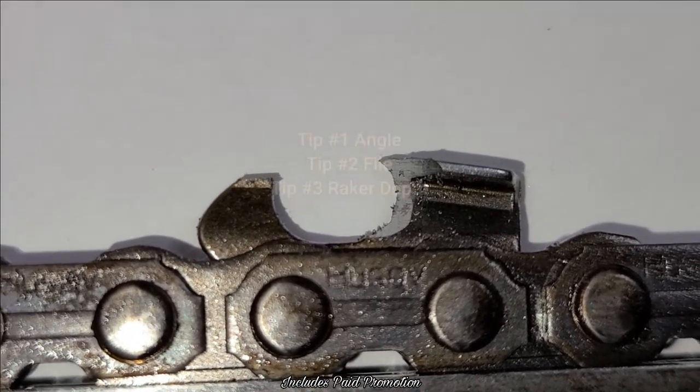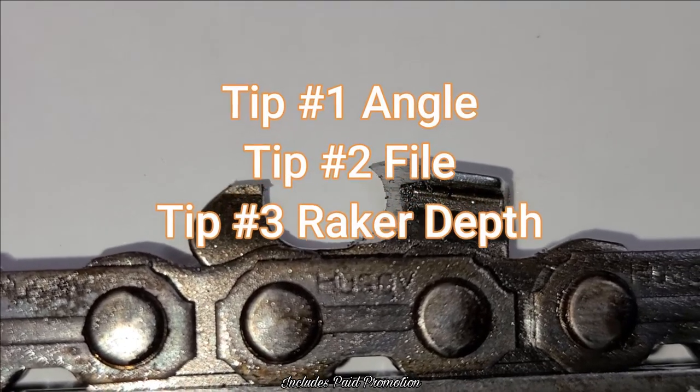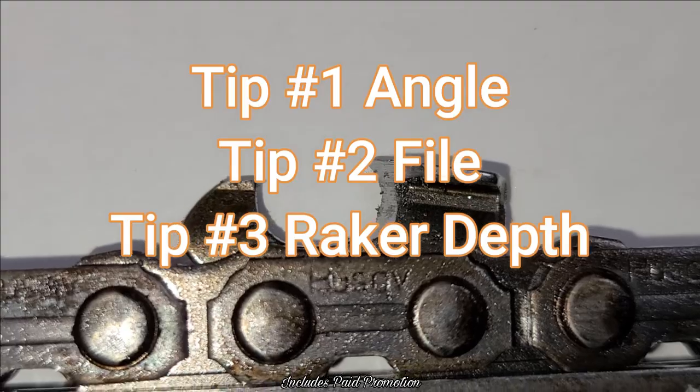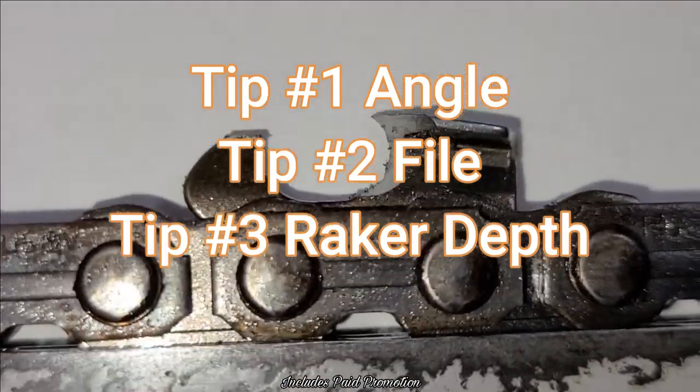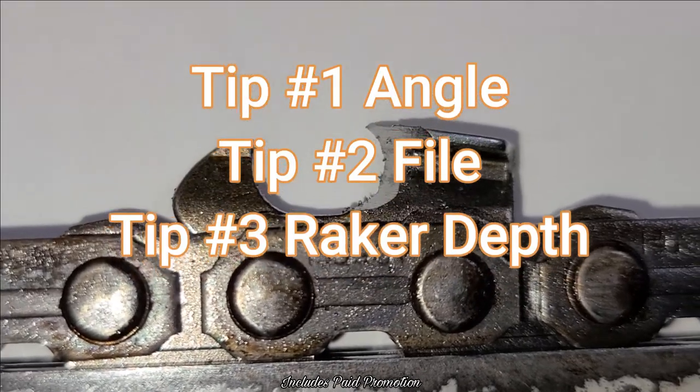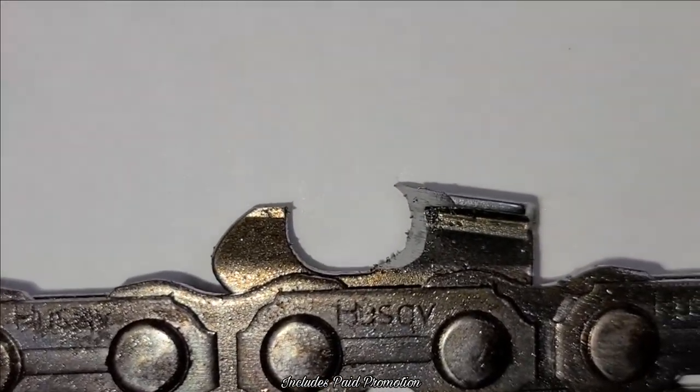That simple. Three easy tips: your angle, the proper file, and what I consider the most important is this right here, the raker, the depth gauge, at the right height. That's simple.